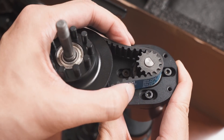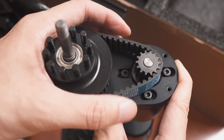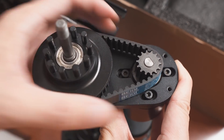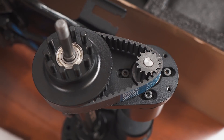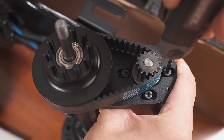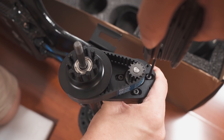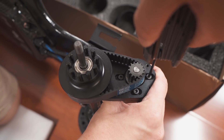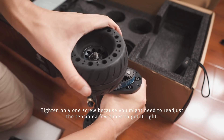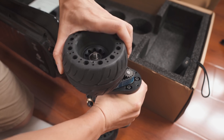When you do this the first couple of times, it might take some trial and error. Basically, pull the motor out so the belt is pretty straight but not fully straight — just watch the footage. So now I'm about to tighten the screws. Once you've determined the proper motor position for the right belt tension, tighten one of the screws first. I'm holding the motor and trying to spin the wheel, just confirming the belt is actually not too loose.